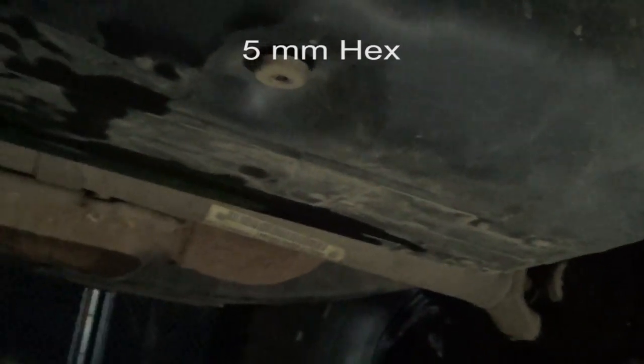So we're underneath the truck. The transmission is at about 120°F. I've loosened this a little bit already. I'm going to put some gloves on - you've got to do this part with the truck running. What you want it to do is hopefully drip out, and then we want it to get to a slow, steady stream - and that's when you put it back in and it's good. In theory. It's a little overfilled - I'll call it right there.